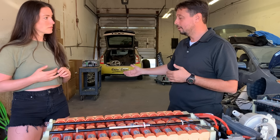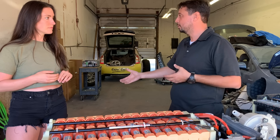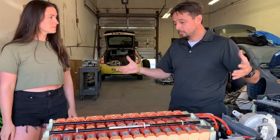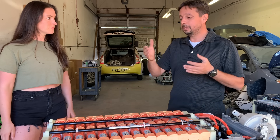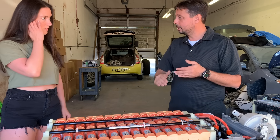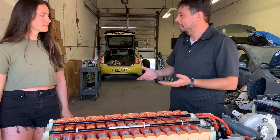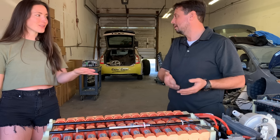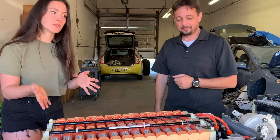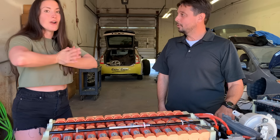So if you have your AC running — AC in this car runs off the hybrid battery, because it's an electric compressor, just like in your refrigerator. So when the car is running and the AC is on while you're sleeping, your battery gets discharged. Then the engine turns on and charges the battery back up, then shuts off and it discharges again. You're not moving, but your battery is still working. That's why a lot of security company cars have no miles on them but their batteries die — they just sit there with the car running. So for Prius owners sleeping in their car, besides safety concerns, it's going to shorten the life of the battery.